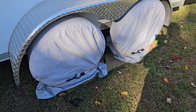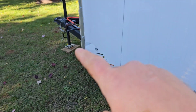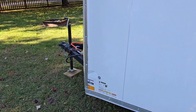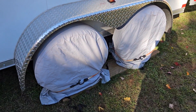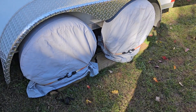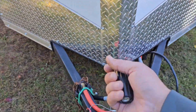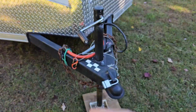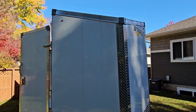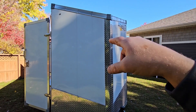When I purchased this green treated 2x10, I bought a 10-foot-long board. I cut one foot off for the jack at the front tongue, leaving nine feet. I cut that in half so I had two boards that are four and a half feet long. Make sure it's green treated, and jack the trailer all the way up so it tilts forward and the water drains toward the back.